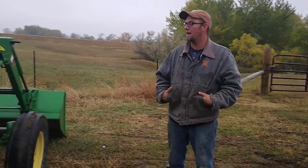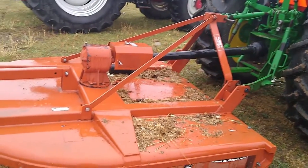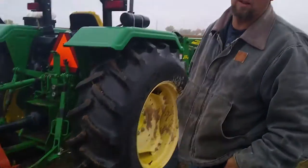Jess just ran it for about 10 minutes and had no issues with it. It ran good, idled just perfect how it was supposed to, had plenty of power just like it's always had. Hopefully with any luck it was just that little screen filter. I did pick up a Wix inline filter — it's three-eighths to three-eighths because that's my fuel line size. I might put that in, I might not. If we have any more problems, I'll probably get rid of that screen filter for a while and put the Wix filter in. You can pick those up at Napa for about $4 and just run those for half a dozen times — maybe $20 in total parts. Thanks for watching, hit the subscribe button if you haven't already, and we'll catch you on the next one.